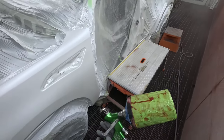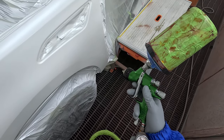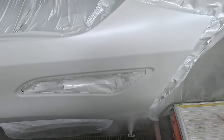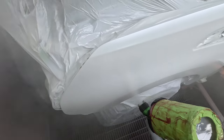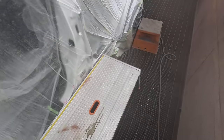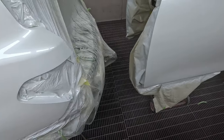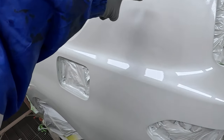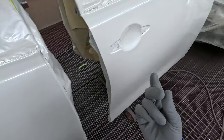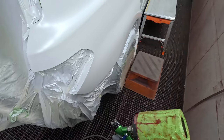Get a nice skinny coat down on your first coat, then I'll turn that pressure down a little on the second coat. We're up at around 38 PSI. That way you actually have a chance of getting a little bit of flash off between coats. Because this clear doesn't really want to dry. There are a couple of spots where you can see through to the base coat — it doesn't matter. This clear does not want to dry without heat. Putting it on so thin actually helps it dry a little bit, to give your second coat something to stick to.